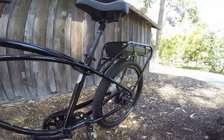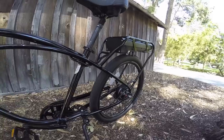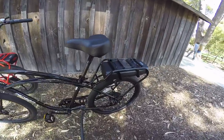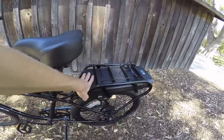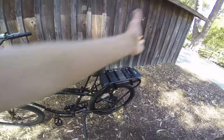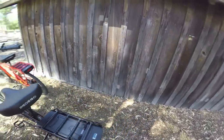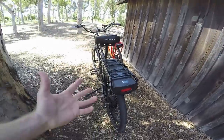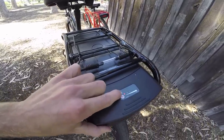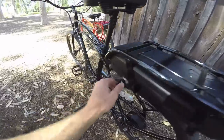The battery is one of the big selling points on the Interceptor. It's an overbuilt bike — a little bigger with all the fixings. The batteries are now only 48-volt: a 48V 10Ah and a 48V 15Ah. The 15Ah gives you more capacity and potentially more range between charges. 48-volt systems tend to be more efficient at delivering electricity. The battery has a little voltage indicator so even off the bike you can tell how full it is.